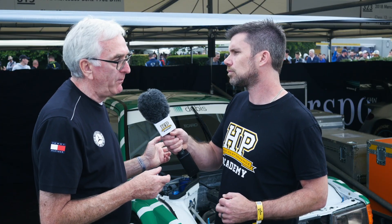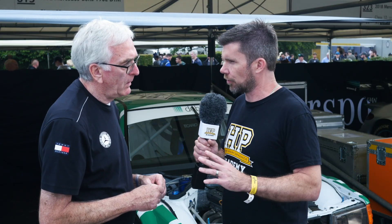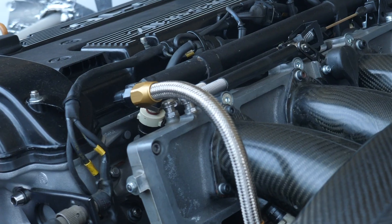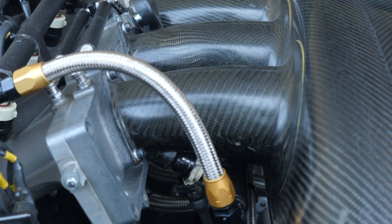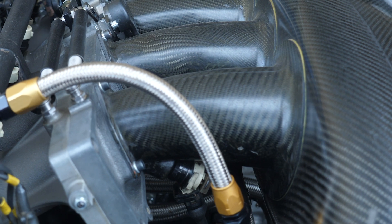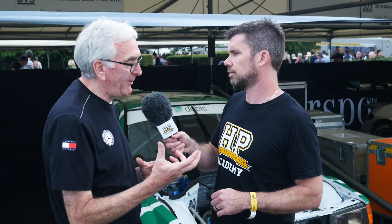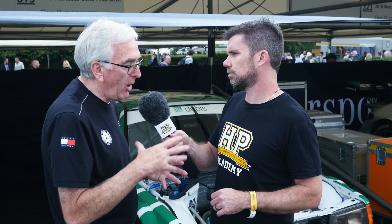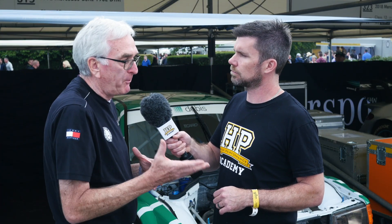The configuration visible on the car was the maximum achievable at the time. There are two or three injectors — one fitted right down by the cylinder head and a second further away from the inlet valve, past the throttle body. Using the Motronic system, you could select which injector was being used based on how the engine was operating, and also adjust the injection timing to set up the engine in the best possible way.